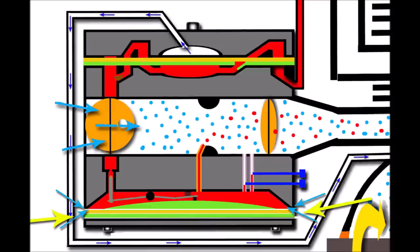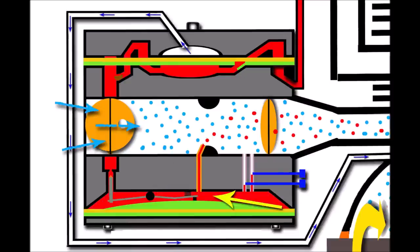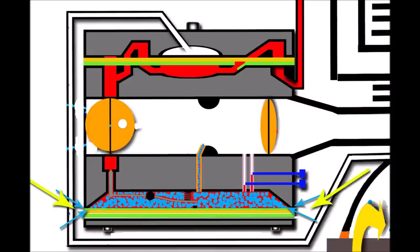So much air fills the metering area that there's no vacuum left there at all. Without that vacuum, the diaphragm can't be drawn upwards and regresses down. In this position it's not depressing the metering lever, so the metering lever pushes back down via the spring — which the vacuum was previously overcoming. With the metering lever back down, the front goes upwards, pushing the needle valve back onto its seat, blocking off fuel coming into the metering area. That means little or no fuel to come up the main jet, and the engine stops.